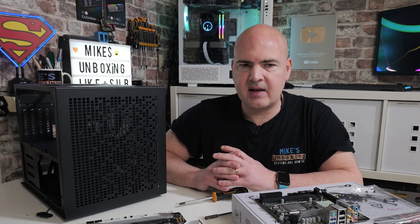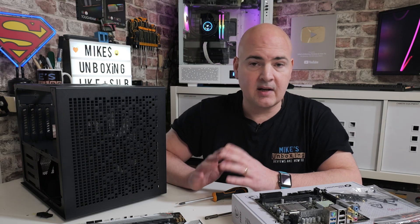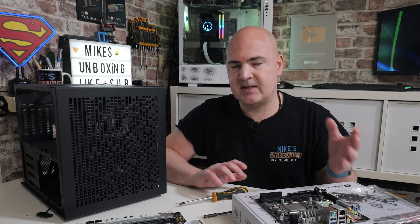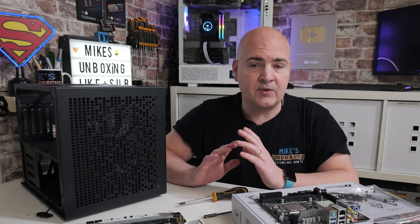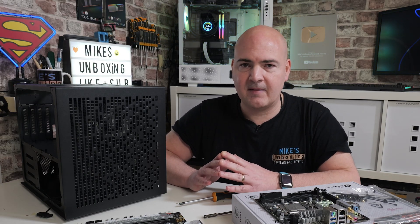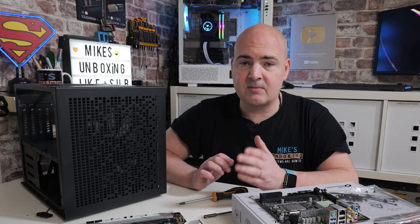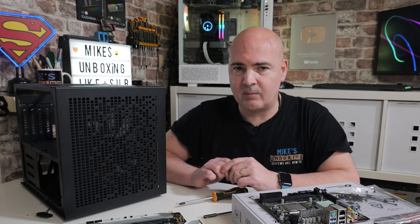Hopefully I've illustrated the problems that can occur with various motherboard layouts in different cases. If you've got a case where the pillars are already installed, generally you're going to be absolutely fine as long as you're matching like with like — an ATX motherboard in an ATX case, micro ATX in a micro ATX case, et cetera. But definitely check before you mount it. Just place your motherboard over the top and make sure all the pins line up and that you can screw through each one of the holes. Sometimes just not having one of those pillars in the right place can cause all the problems and stop your PC booting.